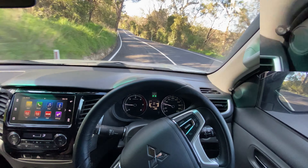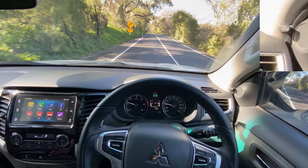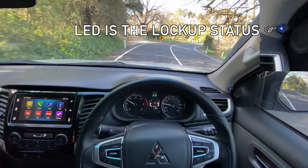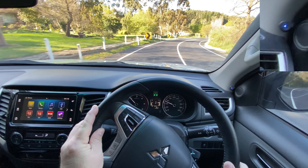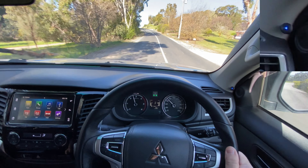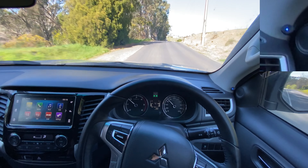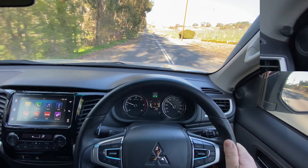But all you need to do is shift into sport mode. I'm in fourth gear there and at the moment we're only doing 1200 RPM — it's too low to lock up. If I drop it back to third gear you'll see the LED has now come on and we're locked. With it locked you get that nice manual feel where you put your foot down a bit and there's no slipping. Using the sport shift to change gears you can see it remains locked up. Now if I go to fifth gear at this speed it unlocked, and that's because I can't maintain lock-up in these conditions.